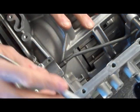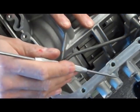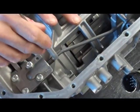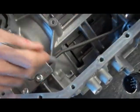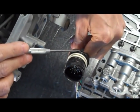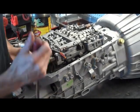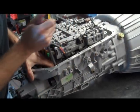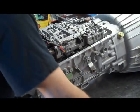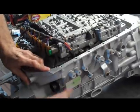On the way back in, the first thing you're going to need to do is engage the electrical connector as you're putting the valve body in. You'll see in the case there's a slotted area — that slotted area needs to correspond with this slotted protrusion on the plug. When that's all lined up and pushed through, you're going to have to push it the rest of the way through with a screwdriver, and then you can put your clip back on.